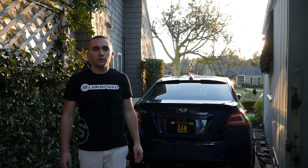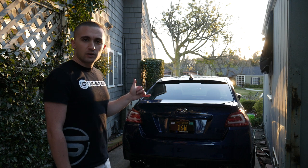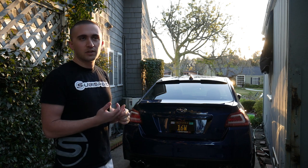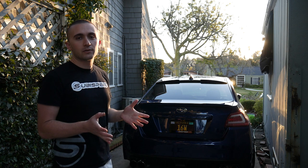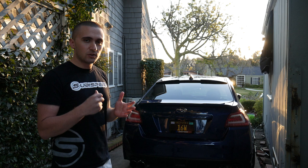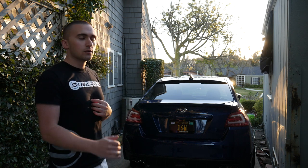All right y'all, so I wasn't able to finish the whole thing obviously, so I just did the trunk and the hood. Came out pretty good, I'm really happy with the results. I ended up going with the orange pad plus the V36, that was the best combination I found. I did start off lighter and it just wasn't enough. It was good, but you could still see some micro scratches on the surface if you looked hard enough. So this got it going.